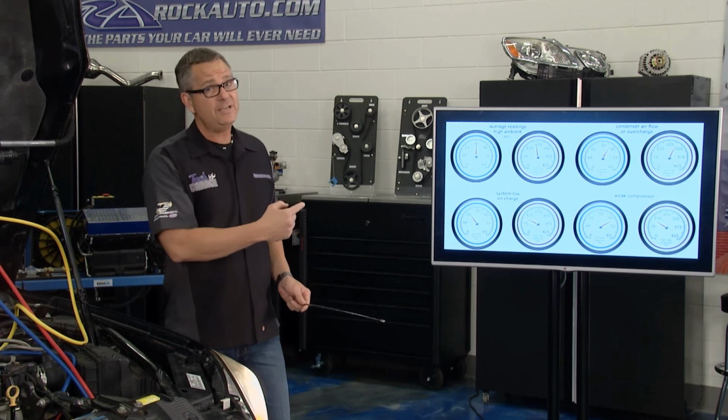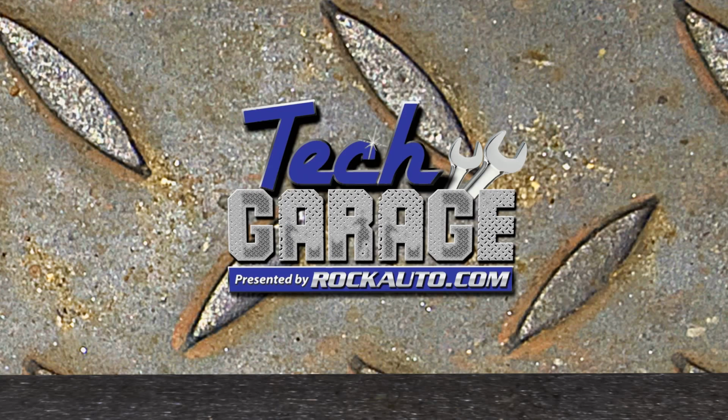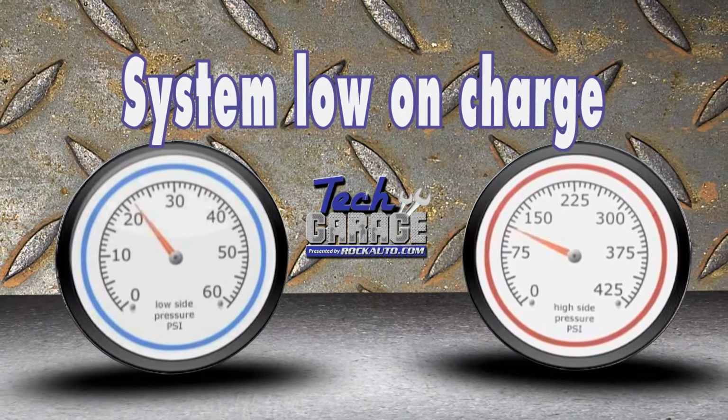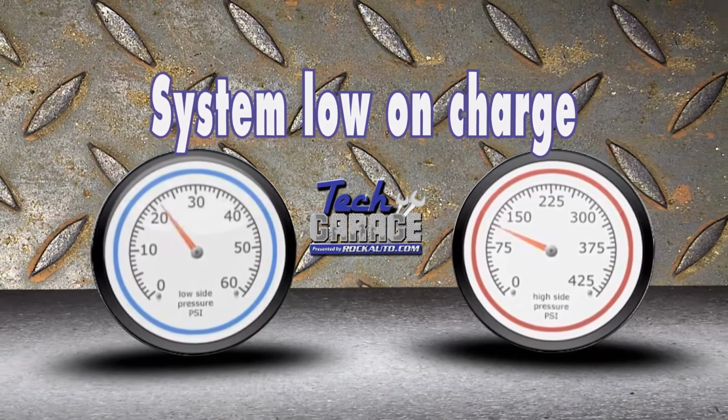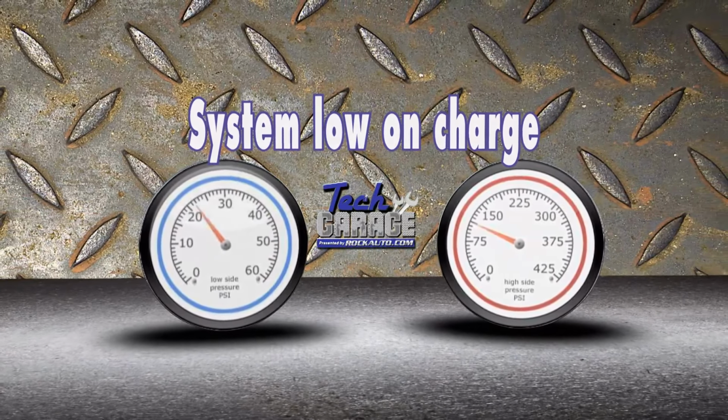And that's also going to affect gauge readings. If it's cold outside, they may be a little lower. If it's hot outside, a little bit higher. Now this one, Brian, this one system's low on charge. It's pretty obvious. Low and low. That one's pretty obvious, right? The system can't push, compressor can't push, and it can't pull to create that balance that we talked about. So low and low is pretty clear what it is.